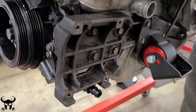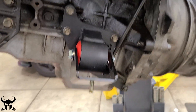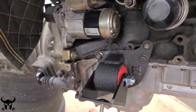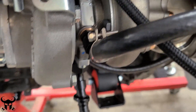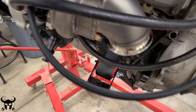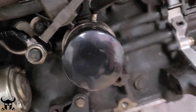Here's the bracket for my air conditioner compressor and then the power steering. I put these engine mounts on and then I cleaned up everything. Here's the oil pan, cleaned up and reinstalled. I replaced these hoses as well. Then I put the starter back in. I cleaned up all this stuff and then I added these lines for the turbo. These are the coolant lines coming from my reroute. And then I added this oil line. The oil line goes around here around the back and this is where the oil line originates — it's right next to the filter.